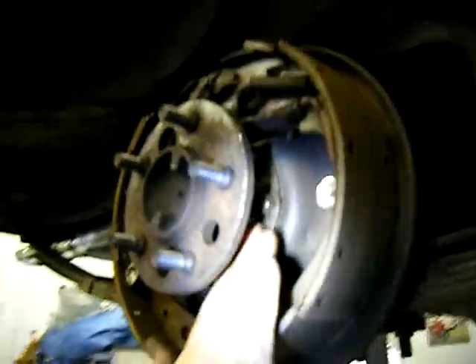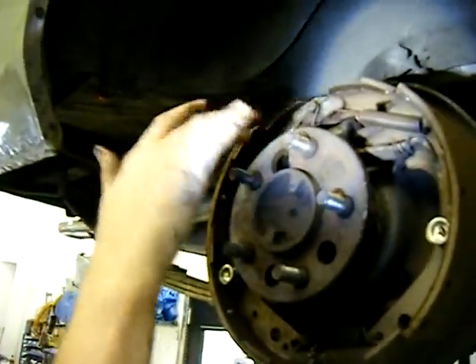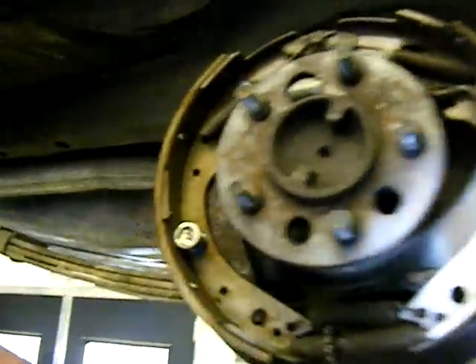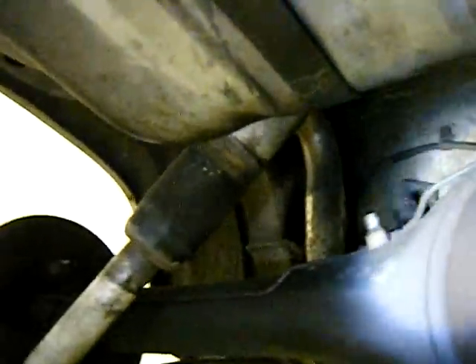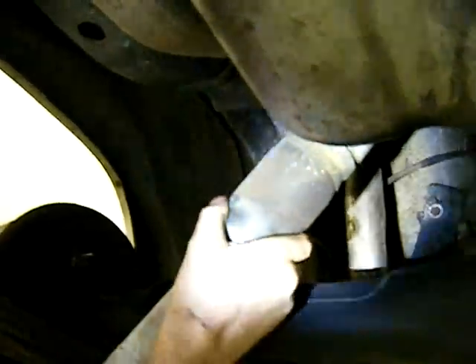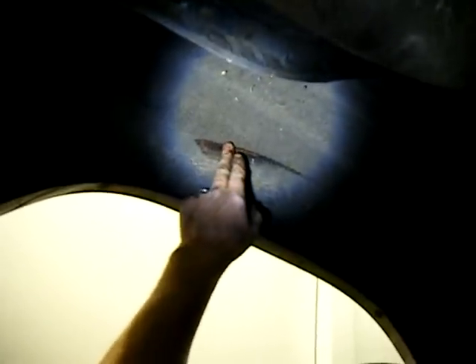It's been adjusted back here — you can see on one side where it's been adjusted, everything looking nice and new. Someone has done some good quality work. New shoes here, still fairly new — no problems with the wheel cylinder there either. But it does have some worn bushings on the air shocks in the back, and on one side you can really see a lot of cracking. The air shocks look like they've been on for a while — whether they're there because the springs are weak, we'd have to let the air out to see. There's also a sign of tire rubbing on the inner quarter panel, suggesting the tires might be a little too wide, or the leaf springs could be too weak and depending on the shocks to do all the work.